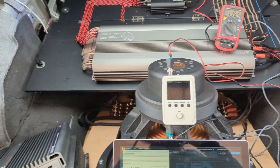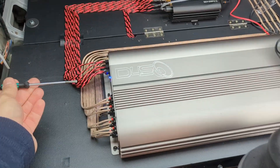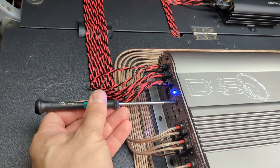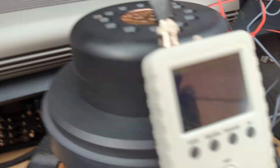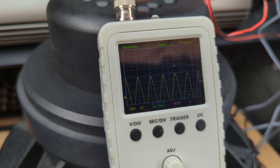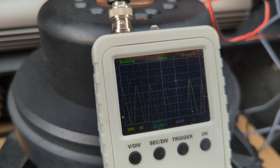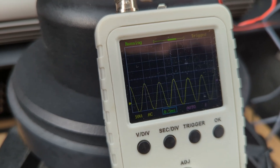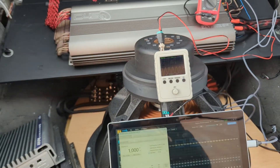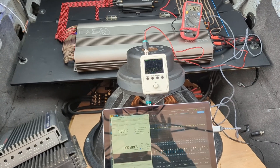At this point most videos say: increase the gain until it starts clipping, then back out — and that's fine. Let me demonstrate: I'll take a screwdriver to channel one and increase the gain. It goes up, up, up, and then it starts clipping. I back out, and this is my maximum output for this channel. That's how everybody tells you to set gains.